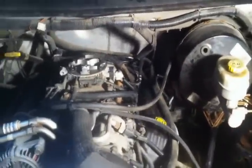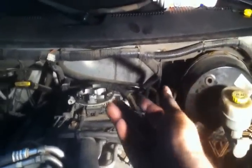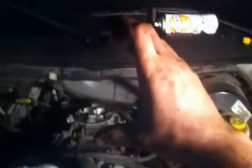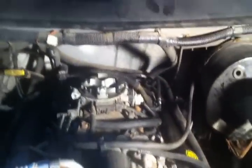There ain't no screwing it up that way, because you pull one wire off at a time, you run the wire back in, plug it up to the old distributor cap. Plug them all back up to the distributor cap. Make sure you take that distributor cap off, because it's going to help you a lot, having that nice and floppy and up higher, so you can get them off easier and keep everything a little more organized. So, get all these other ones on all 8 cylinders, all ran up and plugged up to that old distributor cap.